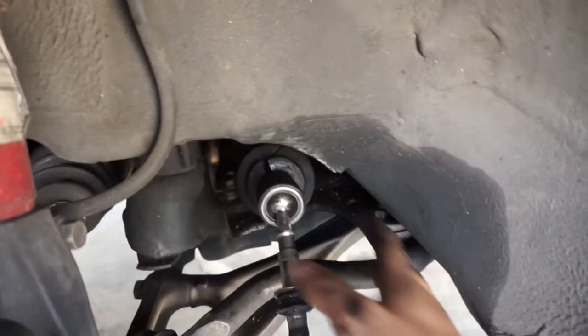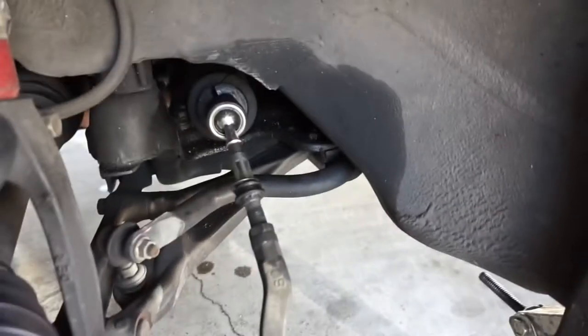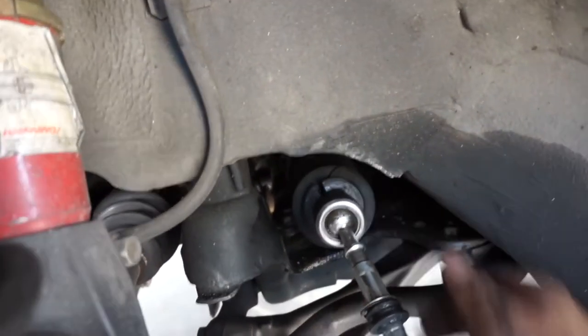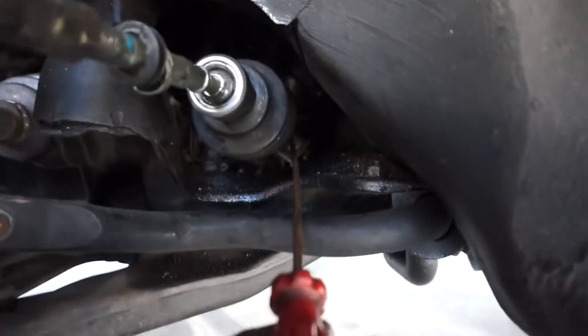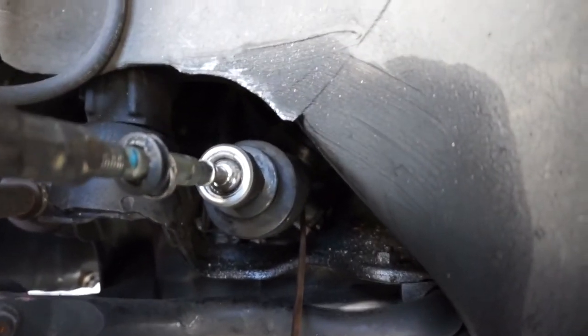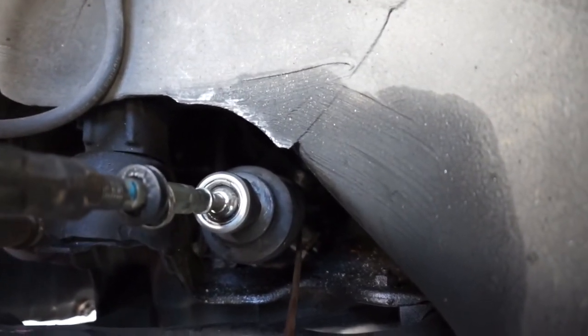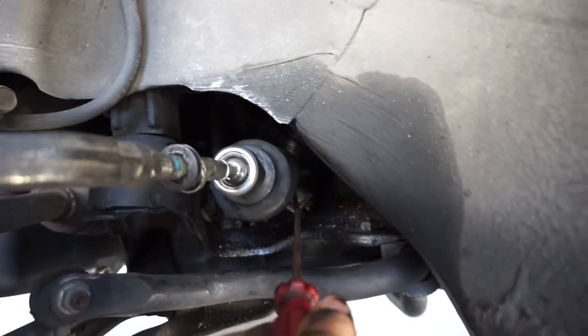I cleaned it up as good as possible. I'm going to put some grease in it, then put the boot in, count the threads, and change the tie rod. The only tricky part is getting back in there to take off that clip. I have a 12-inch flathead screwdriver and it's going to the rear clamp of the bellows boot — basically just going to shove it in, pry, and try to break the clamp free.